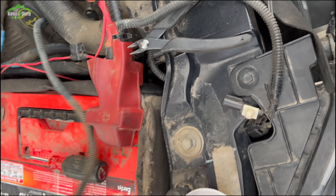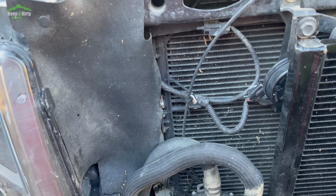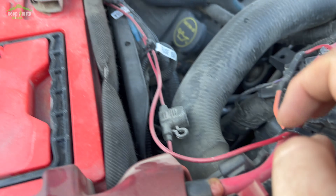That little connector at the top of the engine — the way Roush does it is they tap into it with a Y connector. They actually have this little jumper right here. It's kind of an ingenious way of doing it because they do a Y connector so there's no added circuits or anything and it's a much cleaner install. Problem is, as these trucks start getting older, for whatever reason, that capacitor circuit always stays on. And if that's always on, it's never switching off the water pump. The water pump stays on all the time, killing your battery.